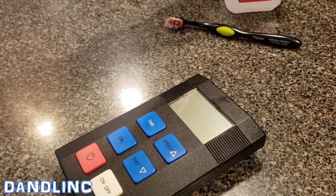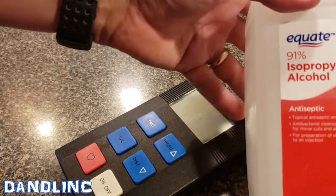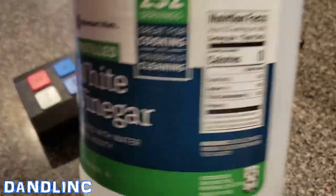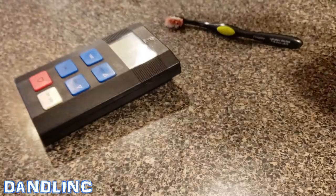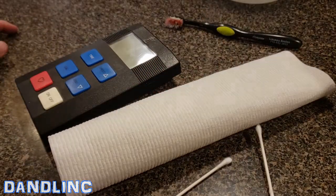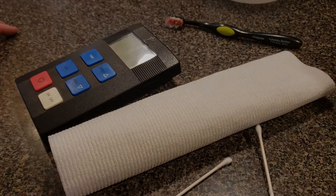That's really quickly how you get rid of a mess created inadvertently by leaving your batteries in during storage, or maybe you've bought something you really like and the previous owner left it in storage. Household chemicals: isopropyl alcohol, regular white vinegar, paper towels, q-tips, and a little patience — and you're good to go. Thanks for watching.